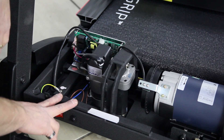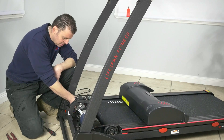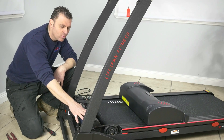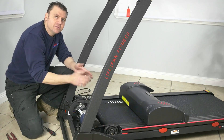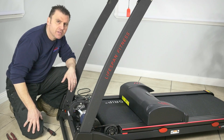You will find two wires that come from the main on and off switch — they go to your AC1 and AC2 plugs. All the board is labelled if you need it, and if you get stuck you can have a closer look. The two wires that come from your motor are red and black — they plug in as M plus and M minus. Plus being positive, minus being negative, which is your black.